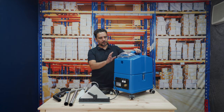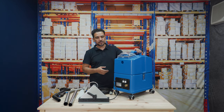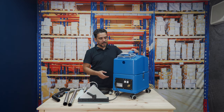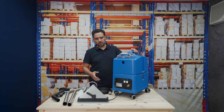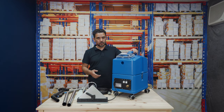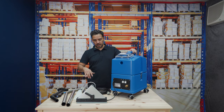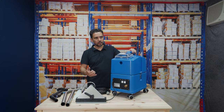The airflow on this machine is really, really high. It uses a heavy-duty two-stage bypass motor which generates really high vacuum pressure. That vacuum pressure is what you need to suck the water out, and at the same time the airflow is really high as well — about 60 litres of air per second — giving you much better flow to collect liquids faster.